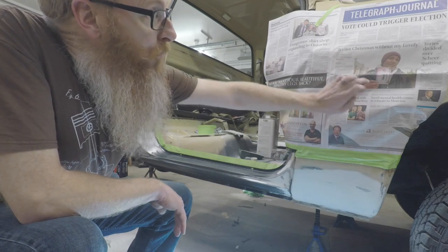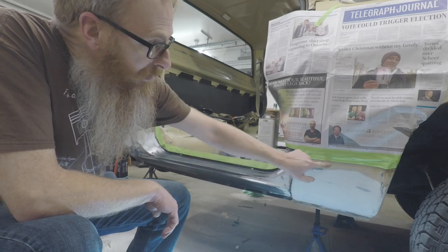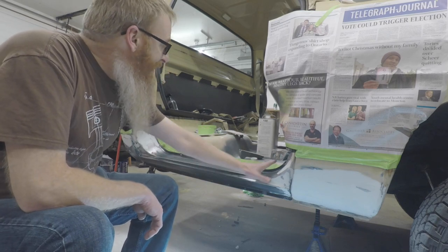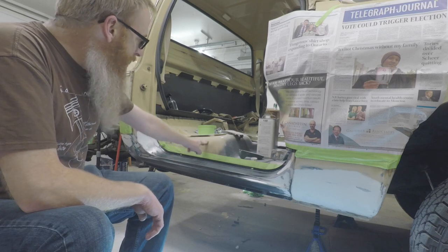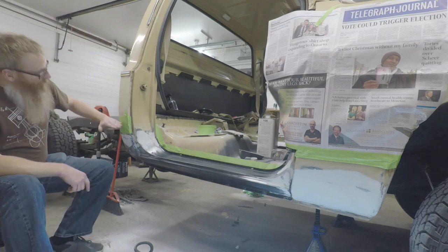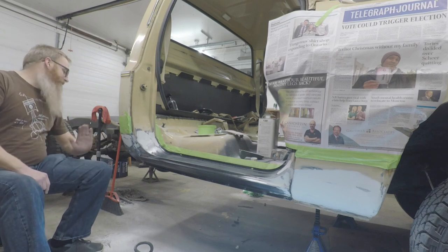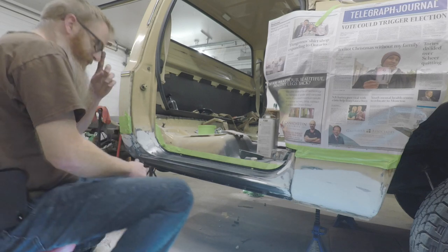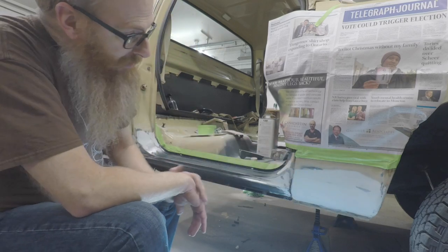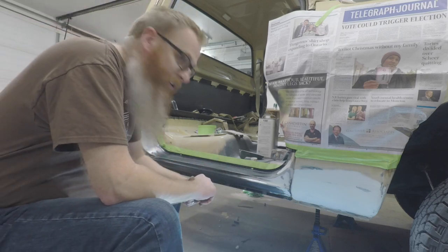We've got this taped up because we don't want any overspray going onto that second color. Inside the door jams is the buckskin color that we're going to be using down here on the rockers. We've got a piece of tape here — I think I can keep the spray down to a minimum, and it doesn't really matter if it blends into that anyways. Over here we're just going to blend that up into the existing color, but we certainly don't want it going further up into the other color. Round back it really doesn't matter. For now we're going to get some primer sprayed on there. We've got to finish scuffing up this rocker and then we'll be good to go.